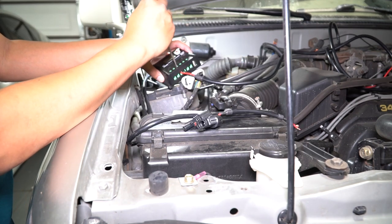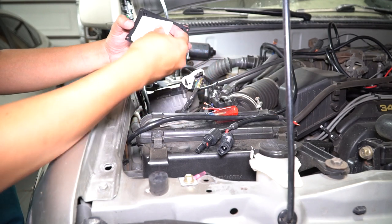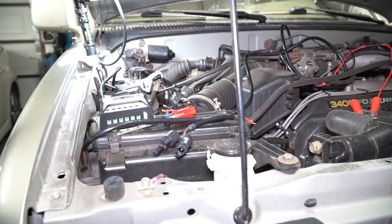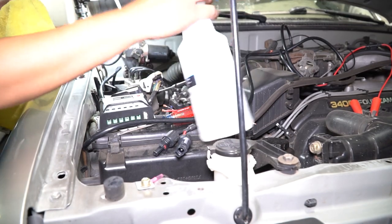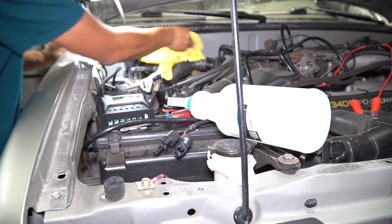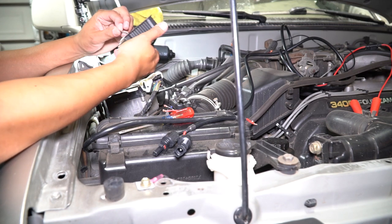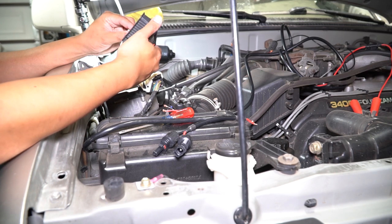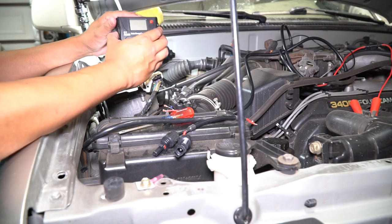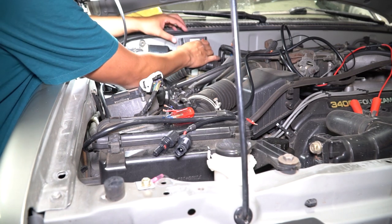The box is labeled so you don't have to remember where everything goes. The box does come with velcro on the back already, so I'm planning on just using the other side of the velcro to get a decent connection. Make sure you clean the surface with alcohol so you don't lose your box in the engine bay. I might upgrade this box to an MPPT controller, which is going to give me more efficiency out of the solar panel. This PWM controller loses some amps generated by the solar panel, but I'm only powering a fridge, so it should be sufficient.